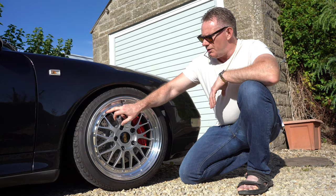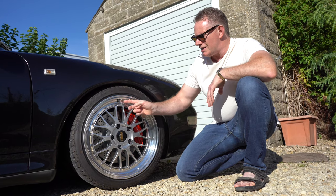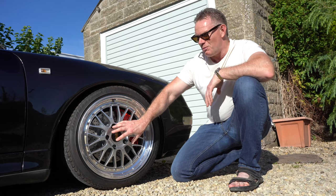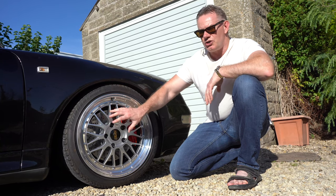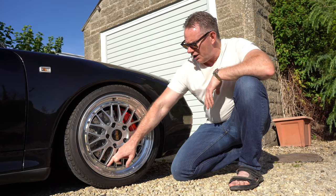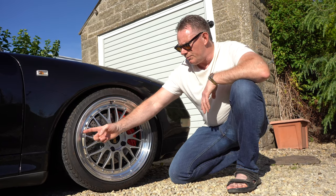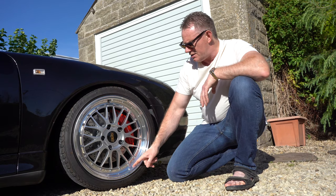When you remove the centre from the rim you expose the front face, which isn't polished — so you then have to get that polished to the same standard as the rest of the rim. The rim section is also lacquered, so you're in a situation where you've bought a brand new wheel and you've got to dismantle it, breaking it from a brand new QA'd state to get the look. You've got to be confident this is what you want and do it correctly, because if you damage it or do it wrong you void the warranty.